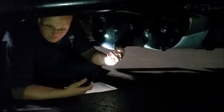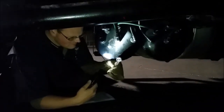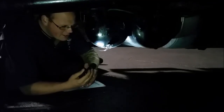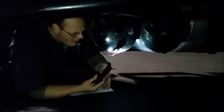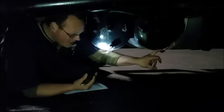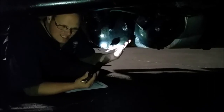As you can see, our supply tank is already empty because it emptied into our secondary tank. While you're down here emptying out these tanks, you want to look for any water or condensation that comes out of the tank — especially out of the wet tank or supply tank. It should have water coming out because that's where all the moisture accumulates. Also look for debris and rust — it'll tell us the state of the tank on the inside.